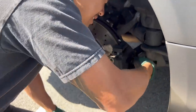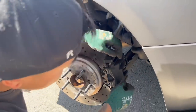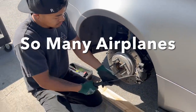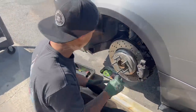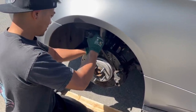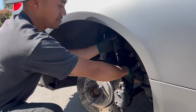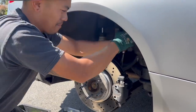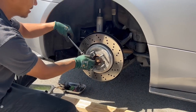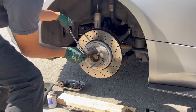The wheel is off and Brandon is starting with the brake sensors and the wires. He's removing the caliper and spreading the pads a bit so he has some space. Two rear caliper bolts, 16mm, to take off the caliper. In order to remove the rotor, it's two 6mm hex. Brandon got it out pretty easy.